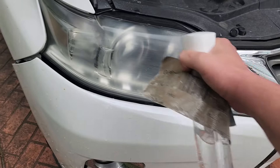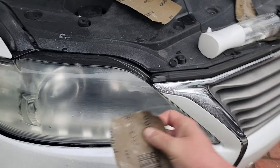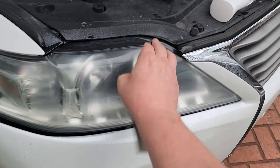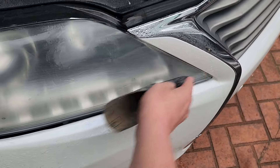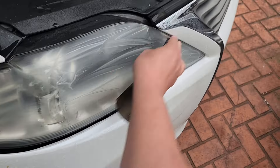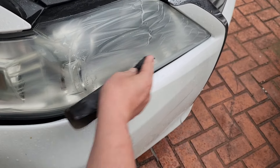I'm going to follow up now with the P600. Again, wetting and sanding with horizontal motions. Fold your sandpaper up to a nice point to get easily into the sharp corners without sanding the metal car body. I'll sand with this grit sandpaper just a few minutes.